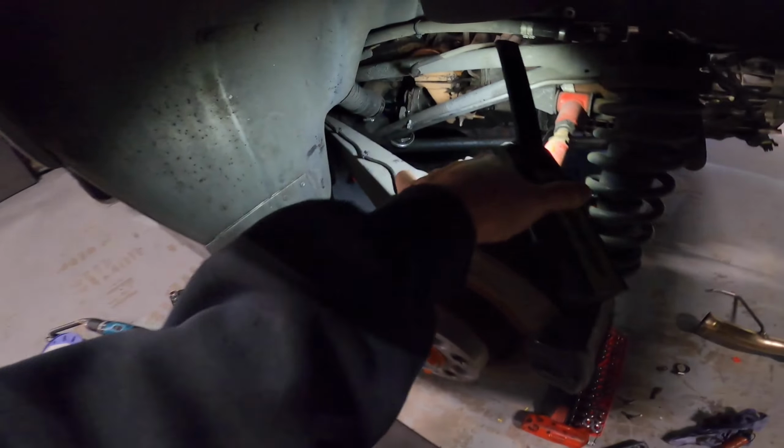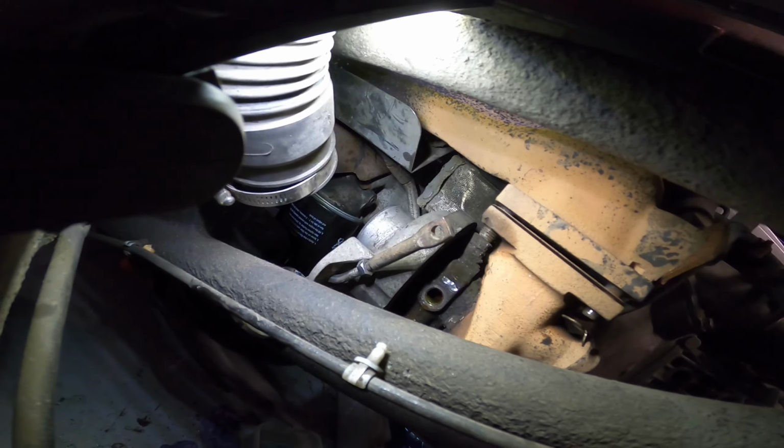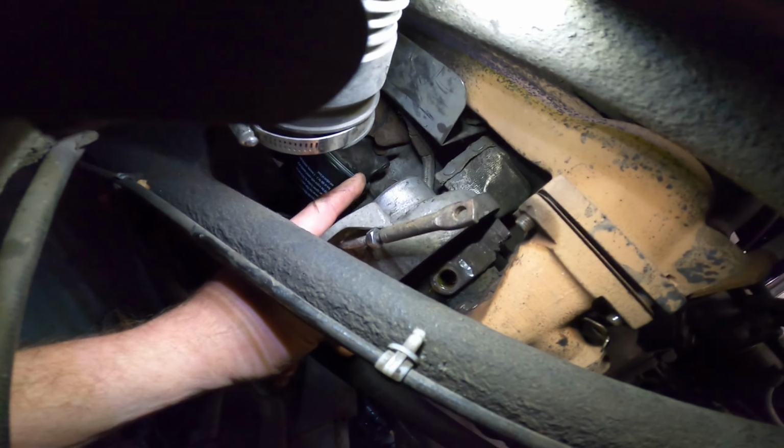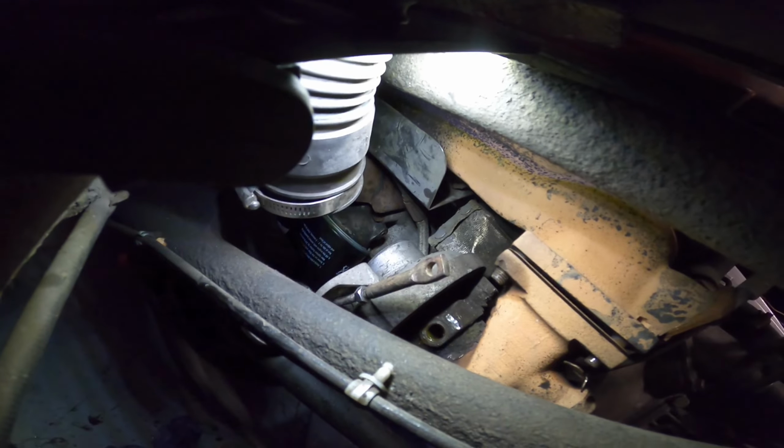If you see that braided line at the very back, let me just see if I can help you out. It's that one there. You see that one just above my finger? So that there is the water feed, which is going in the engine block side of the turbo, and then comes across this side and then up and out. That's the last thing I've got to undo behind the filter. And then we can drop that turbo